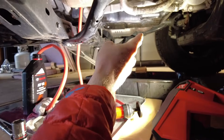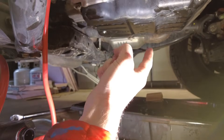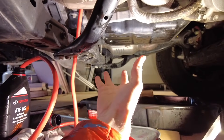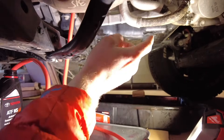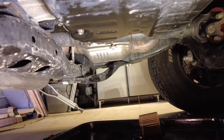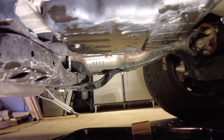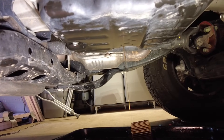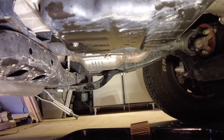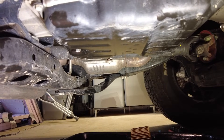I have the check plug on the transmission pan out — it's just on the other side. When the transmission starts filling up, fluid is going to flow out of there. When that happens I'm going to put the drain plug in just temporarily, then we'll do the startup and warm-up procedure to get to the exact fluid temperature and fluid level. You can see the transmission check plug is leaking out — the fluid's super cold right now so I'll wait until it starts dripping a bit more. Don't put the new oil seal on yet because you'll be taking it back out during the warm-up.